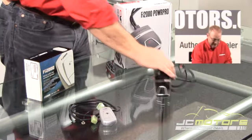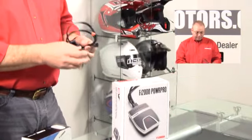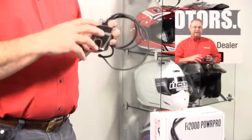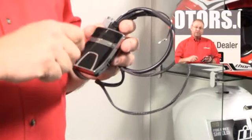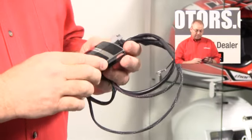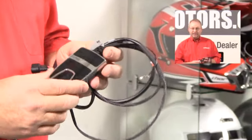Like the other Fi products, it's simple plug-and-play. It plugs into the stock injector, and there are no adjustments. There's no way to get in and tune it because it's tuning itself every time you open the throttle. There are also settings for cruise fuel so it can work with that as well. But for the most part, once you plug it in, all you have to do is forget it and just go ride.